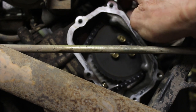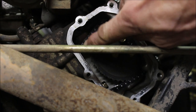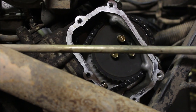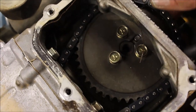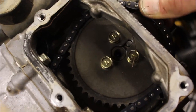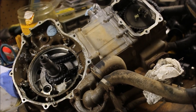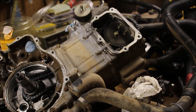The crank isn't turning, it's just the cam turning, and as loose as this chain is it needs to get replaced. Let me show you another engine I've got over here — almost the same identical engine — and there's no free play, it's nice and tight. The story on that engine was the piston seized up, so I'm going to take the chain and tensioner off of that and put it on this one.